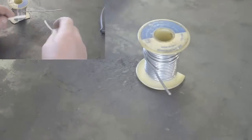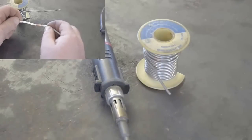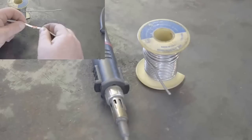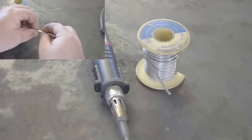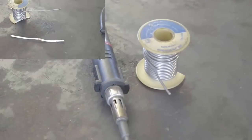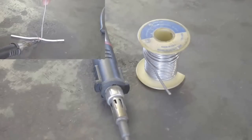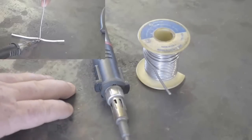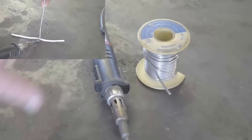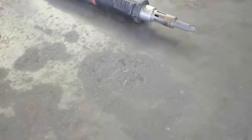The fourth option is solder. Soldering wires together is definitely the best option — you get a very strong connection and a very permanent connection that flows electricity well. When using solder, you want to use some sort of heat-shrink tube around the solder joint to keep moisture out and prevent shorts. That is by far the best option, but it is very tedious and time-consuming, so I'm going to use the best of both worlds.